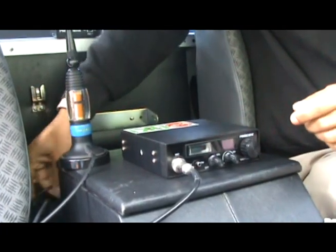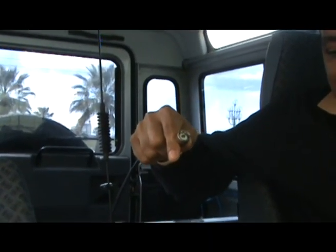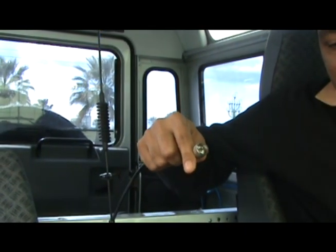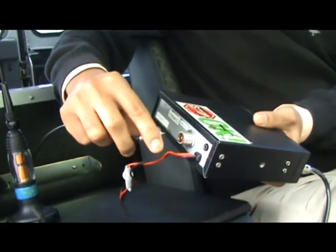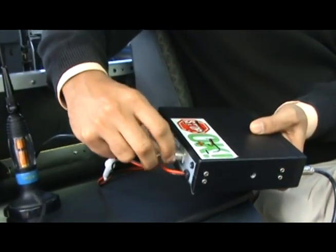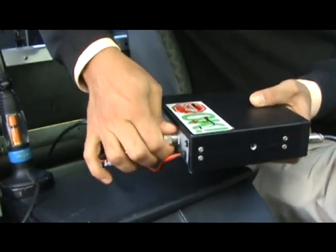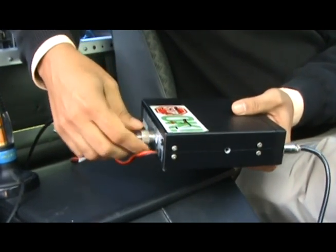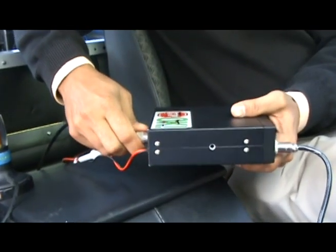What I'm first going to do is connect the antenna cable. As you can see, this is the end of the antenna cable — each President antenna comes with this cable and connector pre-installed. I'm going to turn the CB radio backwards; this is the back of your Taylor ASC 3 radio, and you can see there is a connector pin here. All you have to do is slip the cover over the connector and screw it so the connection is tight. My fingers are turning the connector and it's not moving anymore, so it's snug — your antenna is now connected.